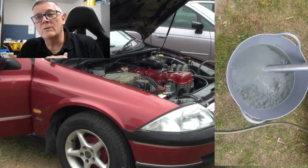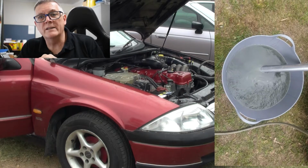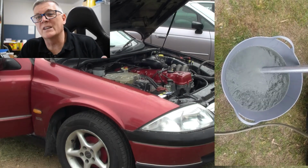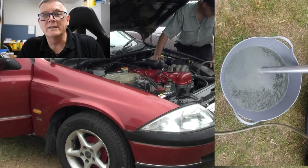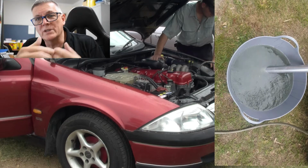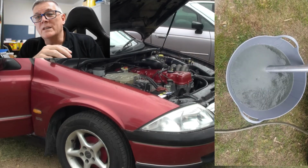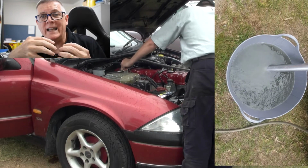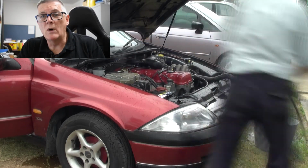And Part B is also an alkaline soap-based compound, and as such, it's a pretty good cleaner. It gets rid of the mud, the sludge, the clay, all those other things that accumulate in cooling systems over the decades. So when you flush out the Part B, it will come out quite dark, if not black, and that's where most of the debris will come away.